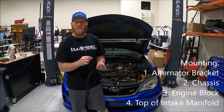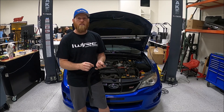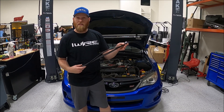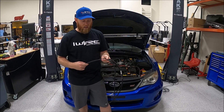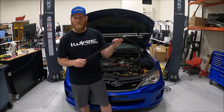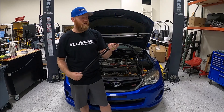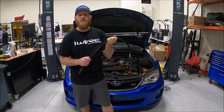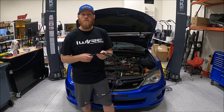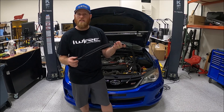Like I said before, the top of the intake manifold is where the grounding for the ECU comes from. So if that is not grounded well, your car is going to have all sorts of weird issues. We're going to keep it simple and also make sure that you can route this cleanly. What you see here is fiberglass sleeve — you can basically light this on fire and it's going to be fine. So you can route it as close to the block as you want, keep it tucked away, make it look really nice. This will work for any Subaru — we have pretty standard link lengths so we can apply it to just about anything.